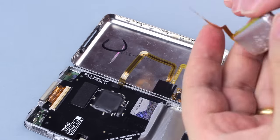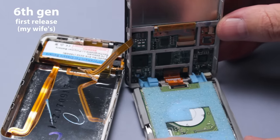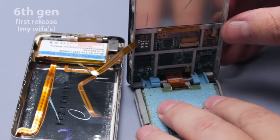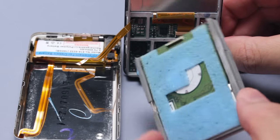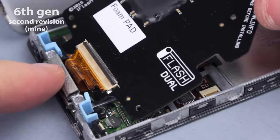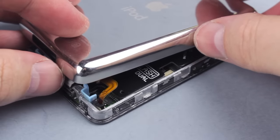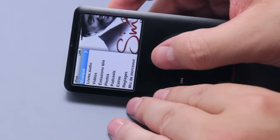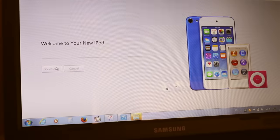Replacement batteries already come with adhesive tape. Peel it and you can glue the new battery in the same spot. To replace the iPod hard drive, you need to release the ribbon from the ZIF connector — hinge open the plastic locking bar using a plastic tool; be extra careful. When the latch is opened the ribbon cable should be easy to slide out. Insert the SD cards on the iFlash board, connect it to the ZIF ribbon cable, be sure it is evenly inserted all the way in, and lock down the plastic tab. Insert the battery ribbon and secure its connector. Verify the iPod is turning back on, then align the back cover and force it down evenly — you should hear the clips locking.